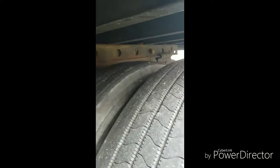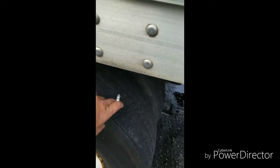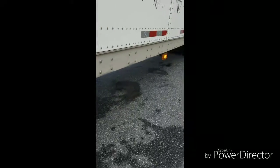On this side, glance underneath and make sure the pins are firmly in place and locked in — which you can see they both are. And again, your tread depth: 2/32nds on your drive and trailer tires, 4/32nds on your steers.